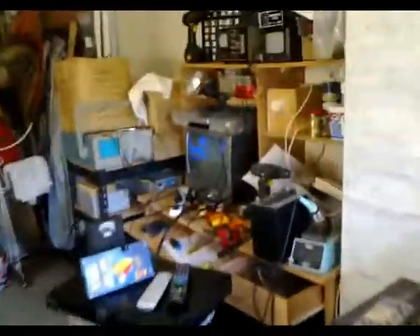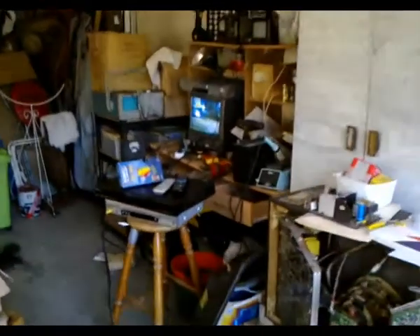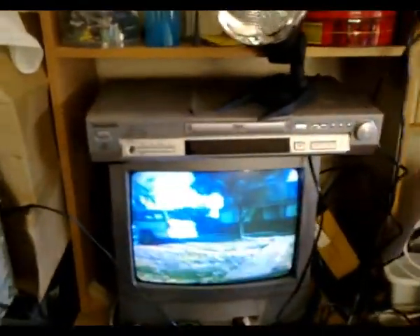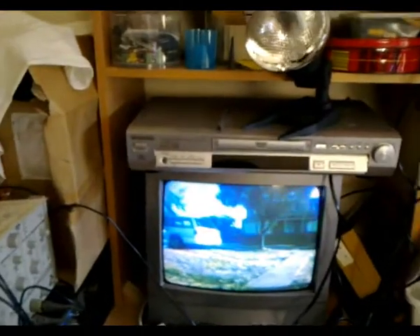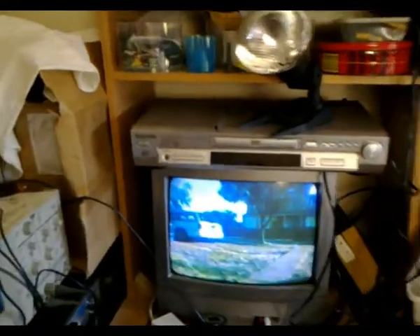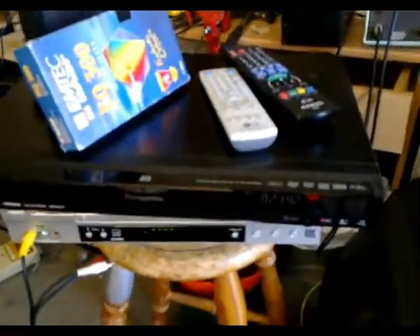Got it hooked up and I'm recording pictures straight to DVD. Yeah, that luminance inversion fault is still prominent once again — gonna get back into gear. All three tubes are going so I'm getting a full RGB color picture, unfortunately however the picture appears to be way off alignment in many ways.